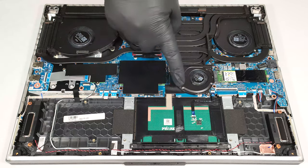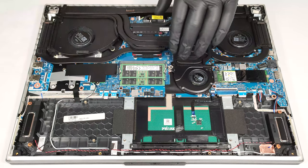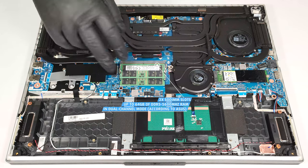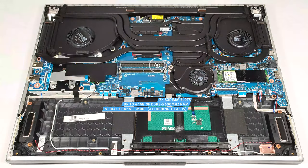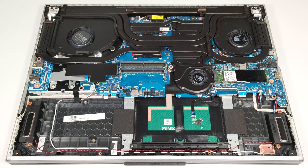The SSD slot on the left and the memory zone are covered with foil. According to Asus, the two SODIMMs can handle up to 64 GB of DDR5 5600 MHz RAM in dual-channel mode. However, since the CPU can support up to 192 GB, this laptop likely wouldn't have issues running a larger amount of memory than the official manufacturer's specified limit. By the way, the memory here isn't additionally cooled with thermal pads, which is a bit strange given the end price of the laptop.